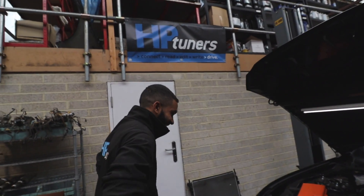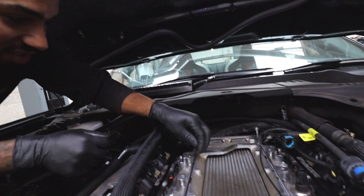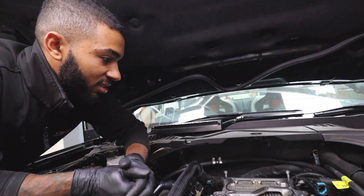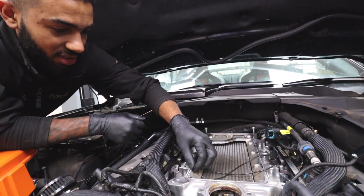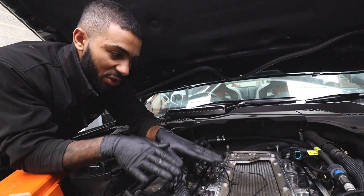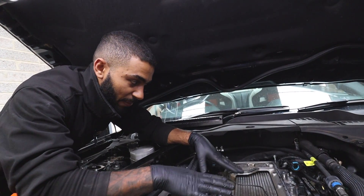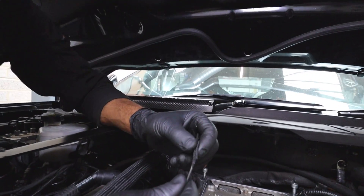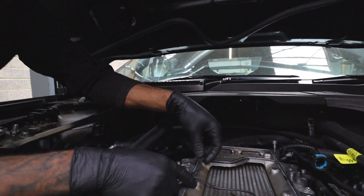There's no silicone in it. You should have silicone in the groove holding the gasket, and that stops it from moving about when you put the supercharger on. Sometimes you've got to shuffle it about a bit, so if they put the charger on and didn't get the holes lined up straight away, they'll have to shuffle it left to right or forwards and backwards, and that rolls the gasket about. You can see the charger's just been sat on top of that — it's not actually been sat in the groove, so it'll have been rolled over and torn. Every gasket's ripped. Amateurs.